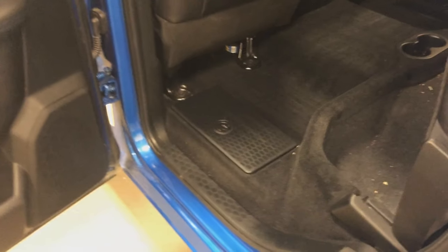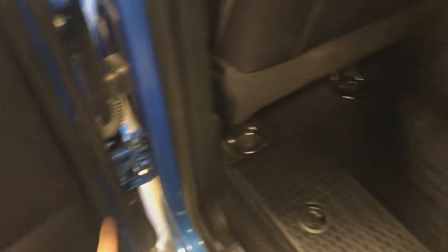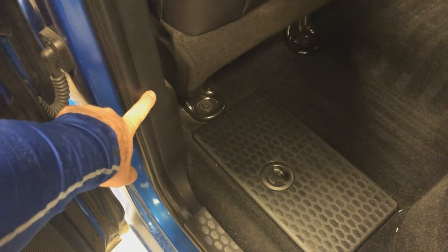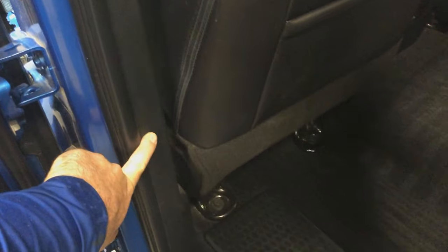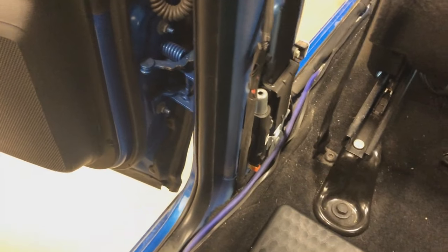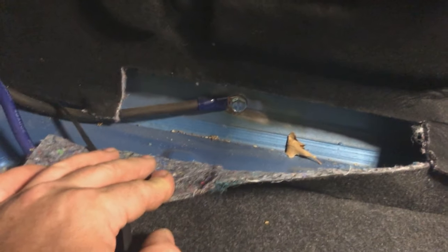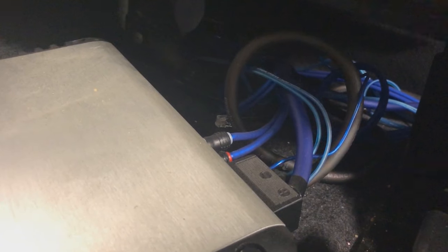The search continues. A fairly standard third location to be tying into factory wiring for a signal is in the B-pillar location where the rear door wiring comes into the cab. To properly disassemble the B-pillar, you have to take off the C-pillar, the seat belt, and everything, which means removing that seat. Now we have the seat and B-pillar cover removed — we're starting to see some evidence of aftermarket wiring. There's power and ground here — at least they scraped the paint off. I've seen worse, but I've seen a lot better. We've got a set of RCAs going somewhere, so the search continues.